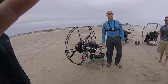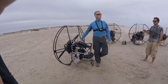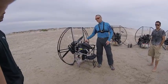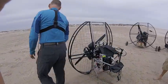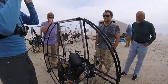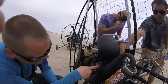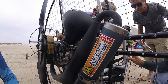The carb is not just a stock carb — it's a Walbro carb with a ton of little modifications to make it work a lot better. If you just buy a stock Walbro carb off the shelf it's not the same. The unit comes pre-tuned from the factory, so you shouldn't have to mess with the air-fuel mixture. There's actually a sticker on the high-end needle indicating it's already been tuned and you don't need to touch it.